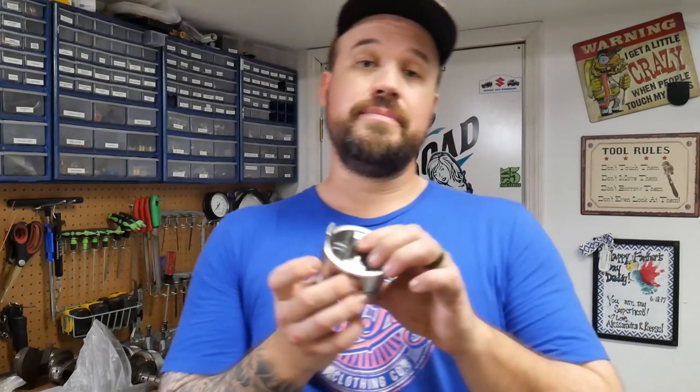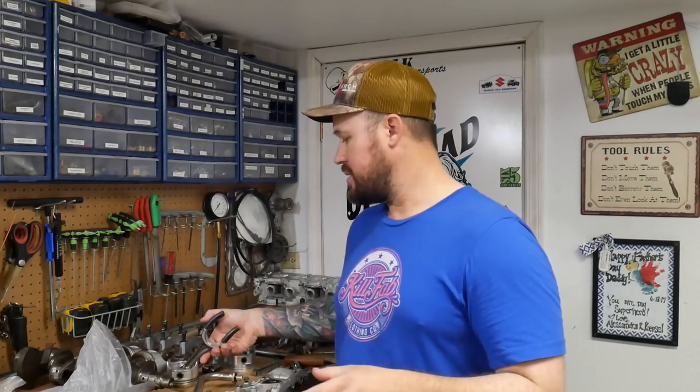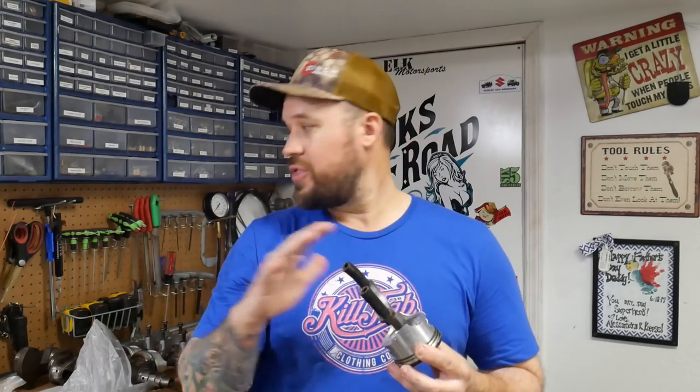And to put the new pistons on, the best way I've actually seen people do it is with just heat alone, which I will show y'all after we get all these pistons off of the connecting rods. Something I want to make mention of is the direction of these connecting rods. Because I'm reusing bearings, I don't want to flip them around. I want to keep them in their orientation on the crankshaft. I don't want to disturb that at all.